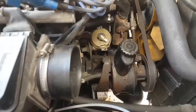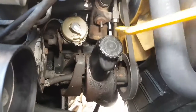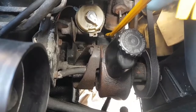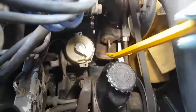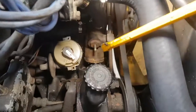Now, I'm trying to replace the main hose coming from the water pump, directly from the water pump here, into the large hose that feeds the bottom of the radiator. Unfortunately, I'm going to have to move the steering pump. You can see that I've got the distributor cap off here — the distributor fits there with all the wires. I've moved that easy enough.